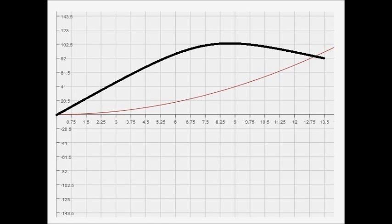As you can see, the clutch would slip all the way to about 13,000 RPM if you ran it this way. So on the next graph I'm going to add more weight to the arms and see what happens.